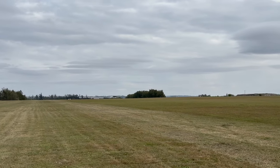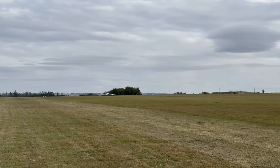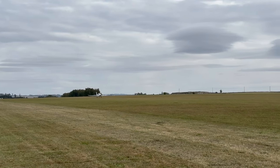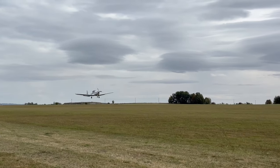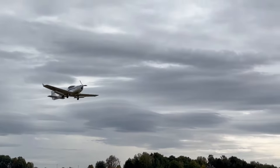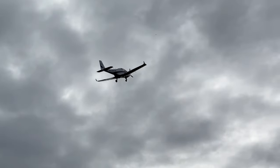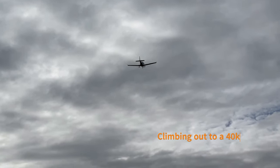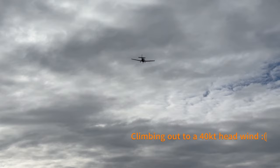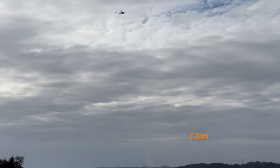With the Sky Leader 600 you have the option of the Rotax 912 ULS at 100 horsepower, or the 912 IS which gives better fuel economy. There is a weight penalty when you add the IS engine, but it makes up for that in fuel efficiency savings, and you also avoid issues with carburettors.